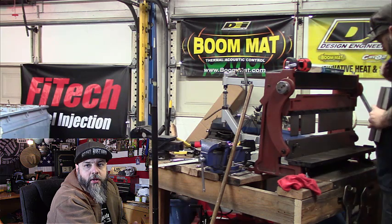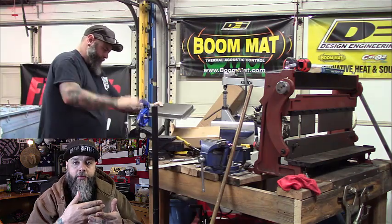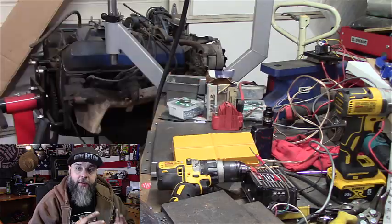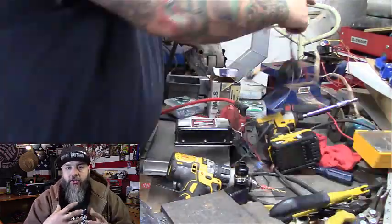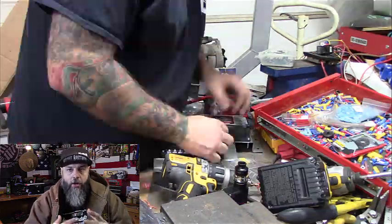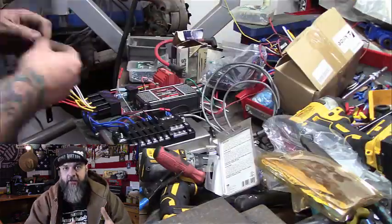First thing I'm working on is building a panel for the passenger floorboard so I have somewhere to mount my fuse panel and a few things like that. I bent this up out of 16 gauge steel - it didn't need to be anything crazy. I put a couple folds in it to raise it off the floorboard so all the self tappers weren't going to be poking through. With the panel made, I'm going to start installing everything on it on the workbench before putting it in the car, just to eliminate time wedged in that floorboard.